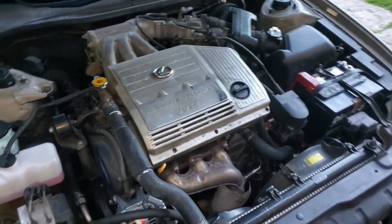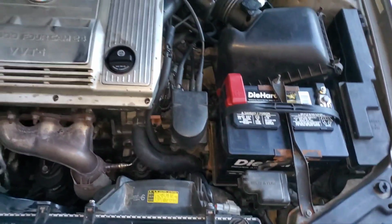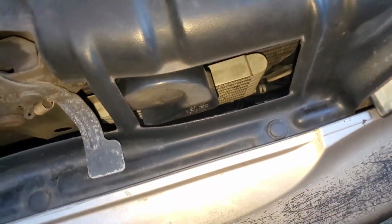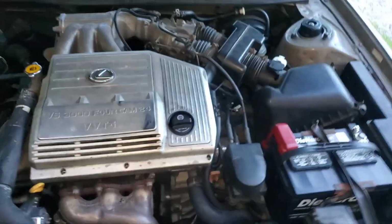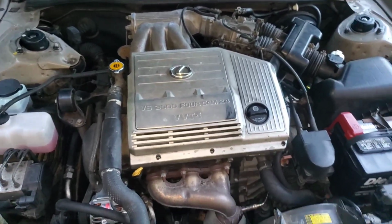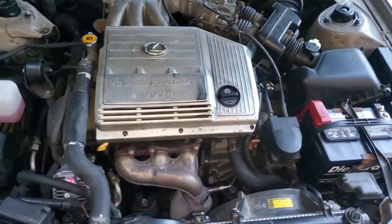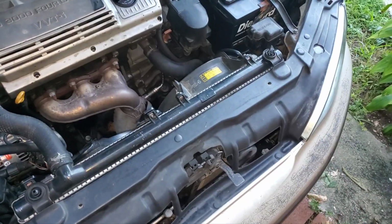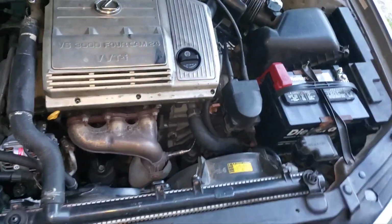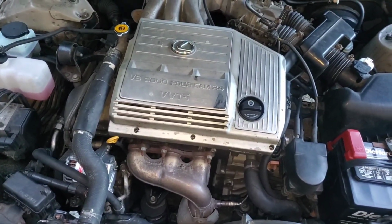Lovely car, aside from the transmission. But hopefully with the cooler, I think any of the V6s that came with this transmission should have come with this Toyota designed cooler to begin with, and that may have saved a lot of people a lot of hassle, especially the Lexus, which is supposed to be the higher end version. We'll see. I do see an objective change in the temperature: the transmission fluid temperature now never goes beyond the coolant temperature, and the coolant gets up to like 203 degrees at its highest. So the transmission fluid temperature is pretty much regulated there.